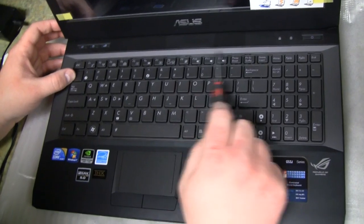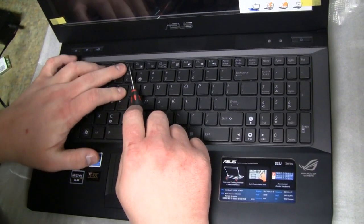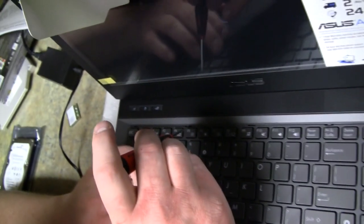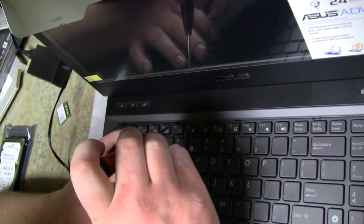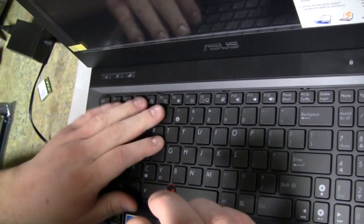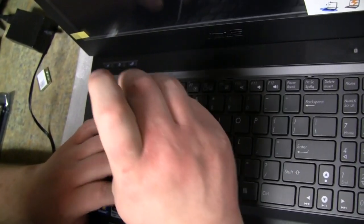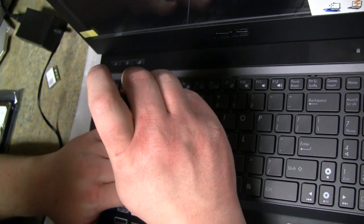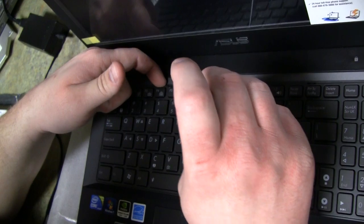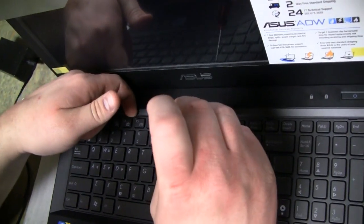There are five notches at the top here. We're going to label them one through five. We aren't going to start with one — we're going to start with two. The idea is to get the screwdriver down in the notch so you can push the little latch out of the way and then quickly remove it. You can see the keyboard popped up a little bit. Press it back down, it locks like that. Press it out of the way to remove the keyboard. Move on to three — you've just got to press it in just right and then remove it quickly.